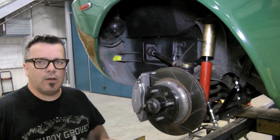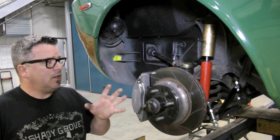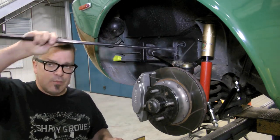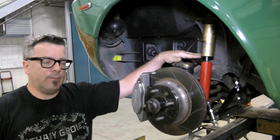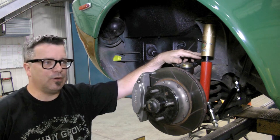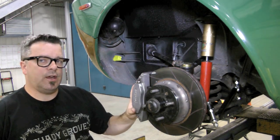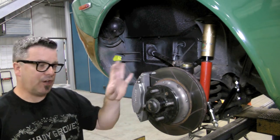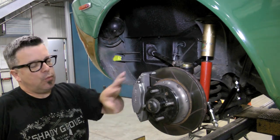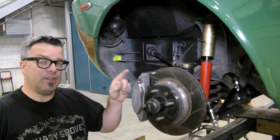I wanted to backtrack and give you a good understanding of where we are. This piece right here is the camber arm - this is the piece that broke on me. I've never seen one of those break ever. Importantly, you cannot adjust camber with the car sitting on a jack with the wheel off. It has to be in its fully relaxed ride stance. Even if you put the wheel back on and lower the car, it's not ride stance - the car has to be moved around and settled into its position. At that point, then you can actually adjust this.